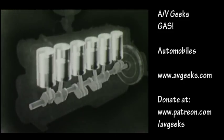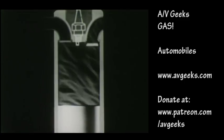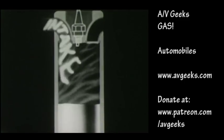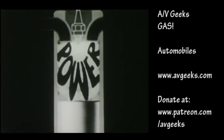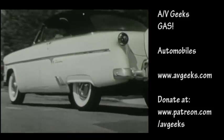So we see that each cylinder of a gas engine in an automobile has 4 strokes: intake, compression, power, exhaust. And these 4 strokes are repeated over and over again, many times a minute. The force obtained from the movement of the pistons up and down in the cylinders is used to turn a shaft, which transmits the force to the wheels. And that's what drives an automobile.